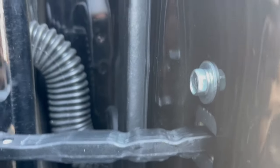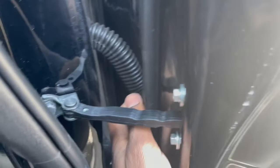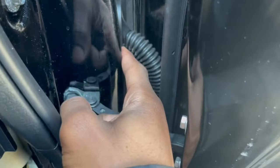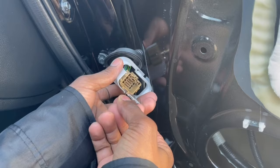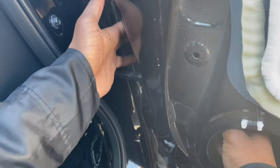You're going to snake your hand up here — it's going to be difficult to record — until you find the hole and unplug the door harness. Pull it down and there's the connector — I unplugged it. Now we're going to push this into the door, freeing it up. There is also a plastic clip that's a little tricky — you're going to use a tool and pull it forward, and then it comes out. This is really difficult to take out, not going to lie.